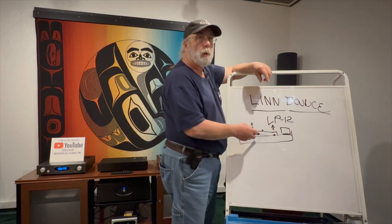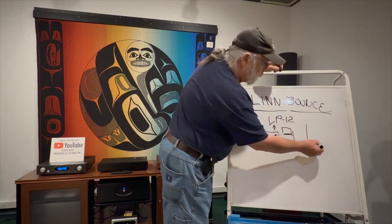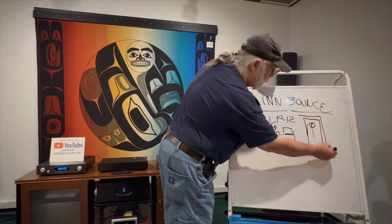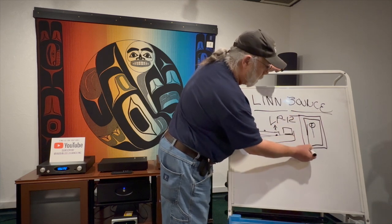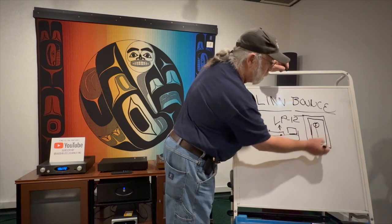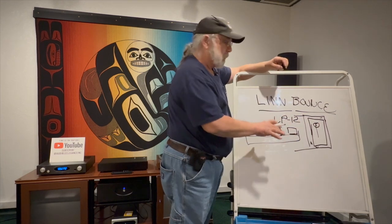So that's part one. The other part is, as it's bouncing up and down vertically, if you now look at the arm board, the tone arm, again, the plinth coming around, there's the top plate. This should be moving vertically as well. There should be no twisting at any corner of motion. In other words, it's not doing this sort of thing. That's getting the bounce proper.